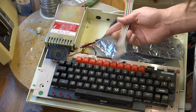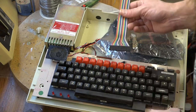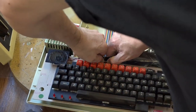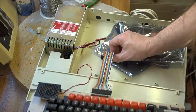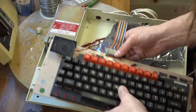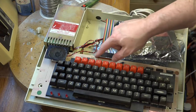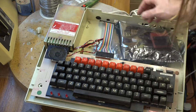Another thing I bought was this cable here. It's slightly not the right size — slightly too many wires — but I bought it because if you've got a nice long connector lead going from the keyboard to the main board, then what you can do is actually move the keyboard out of the way while still being connected to the computer. I think that's quite a good upgrade, and also the pins fit very snugly on this cable, whereas the old-style cables do work loose after a fashion. I've got these in my other BBC Micros as well.